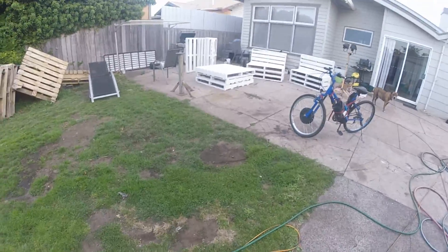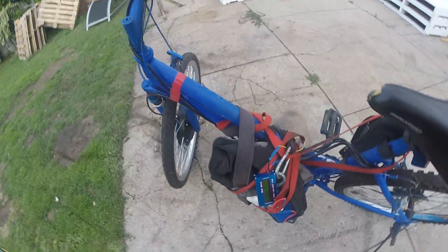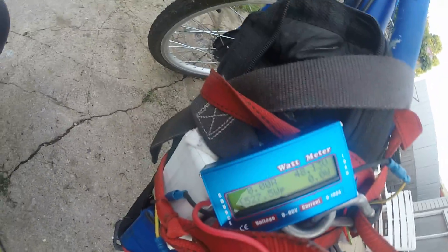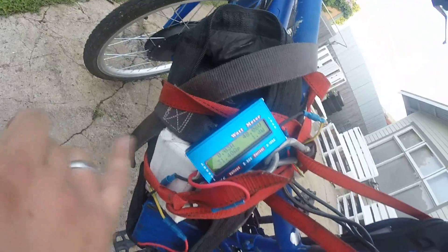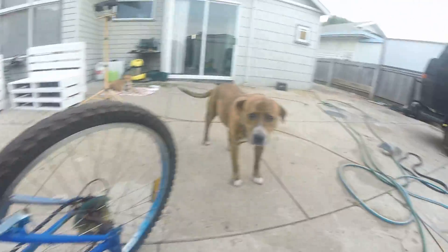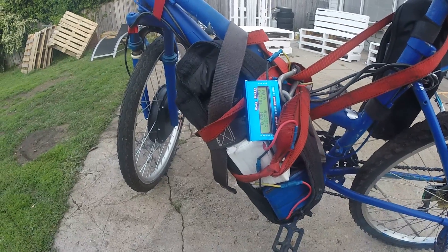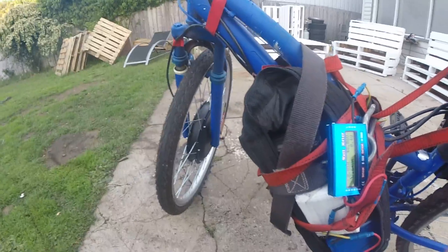That's about 30 amps at 48 volts. I'm running 52 volts theoretically — I've got an extra pack; the white one's the extra one. We started off at 55 volts this morning and I've used nearly over 200 watt hours already — 31 amps at peak. The 18650 packs are holding up beautifully. Anyway, thanks for watching. We'll make this a bit better, add a carrying rack to the back for the batteries, may even make the pack a bit bigger. I'll keep you updated on my electric bike projects. Thanks.